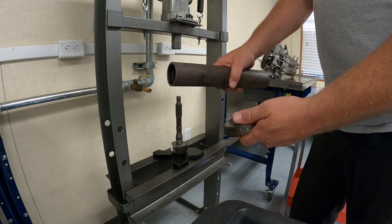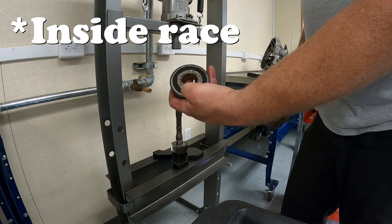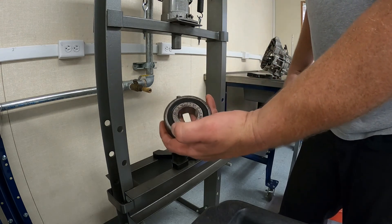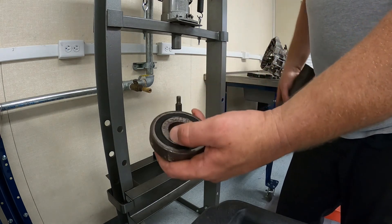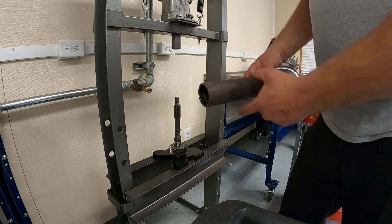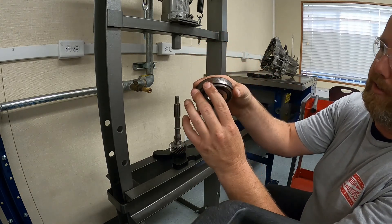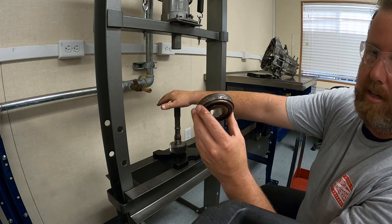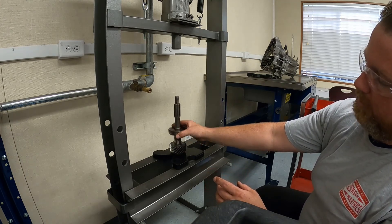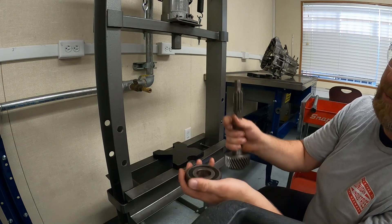Our bearing we want to make sure it's spinning freely and that the bearing installation pipe is only acting on the inside diameter - we don't want it pressing against the black bearing cage cover, which is just a plastic cover to hold the grease in for this roller bearing. That cover can't take any force - if you crease or dent it at all, basically the bearing is finished. So we press just on the inner race where we have our interference fit. We also need to make sure the bearing is oriented correctly - this bearing has a step in it, and per service information for this NSG 370 input shaft, this little step has to go down towards the input gear.